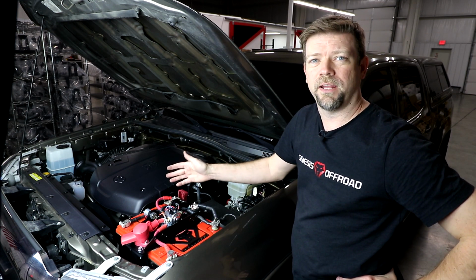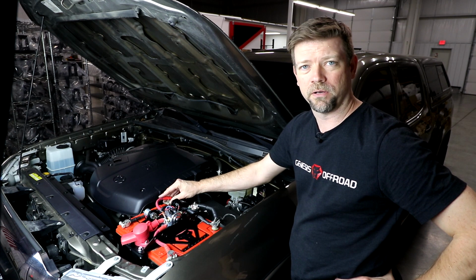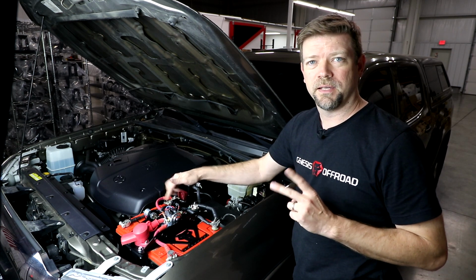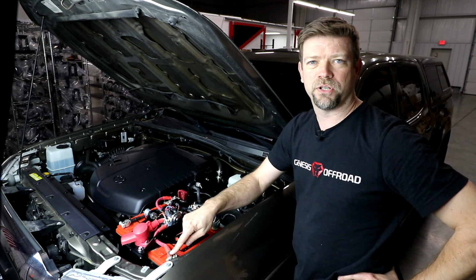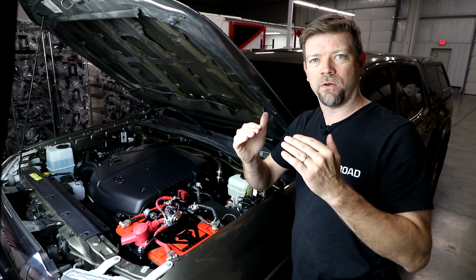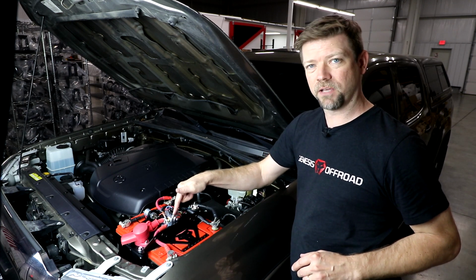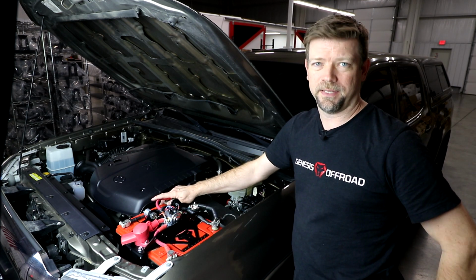So when you start your engine, the alternator is going to be charging up the cranking battery first because it comes directly into this battery. So this battery is always going to be charged by your alternator. And then when the smart isolator here sees your cranking battery above 13.2 volts for 2 minutes, it's going to close the contacts inside the solenoid, link this red wire through the solenoid over here, and that way your alternator will start charging up your accessory battery as well. At that point, they're combined together, acting like one big battery to run everything in the vehicle. And then as those batteries start to drain down, when they hit 12.7 volts for 1 minute, which is still a pretty high voltage, this is going to separate the contacts inside the solenoid here and leave the accessory battery for running your accessories and leave your cranking battery for starting the engine later.